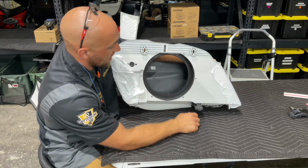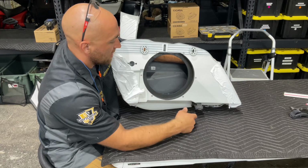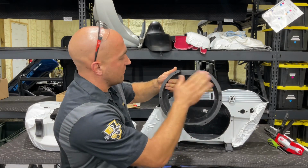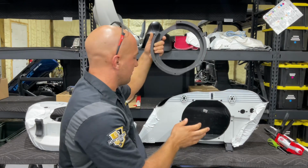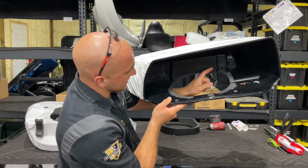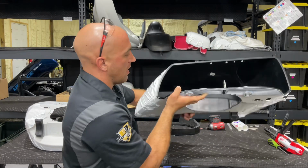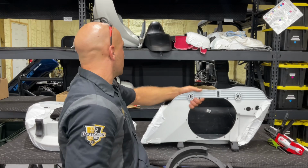And then these are wrapped, so let's go ahead, get both of these sanded up, get some panel bond on them, and get them reinstalled. So off camera, like I told you before, we took the ring, we scuffed this up with a good 80 or even 30 grit sandpaper, whatever you have that's really rough. And then, like I'd said before, you can see where we sanded the inside of the bag just around this ring, to give us a nice, real secure, rough bonding surface. So what I'm going to do is set these back.